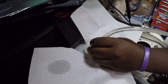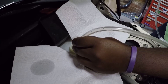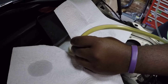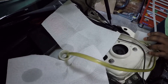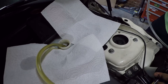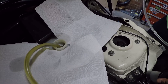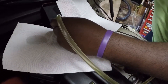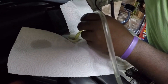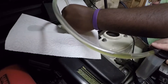The first step is to suck all the old fluid out of the reservoir, so that you're not contaminating it with the old junk. Keep in mind brake fluid is corrosive, so try not to get it on your paint — which is why we're using these paper towels here, to make sure we don't get any brake fluid on the paint, because it will pull away the paint.